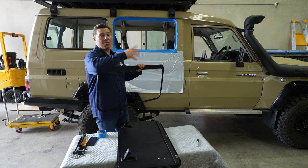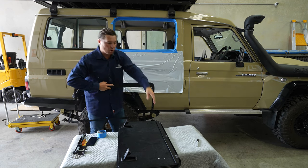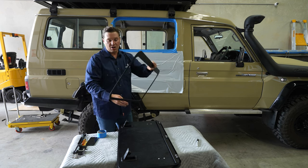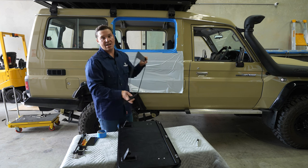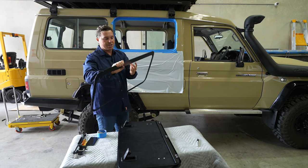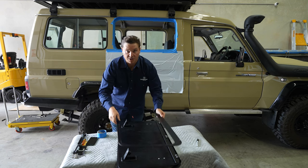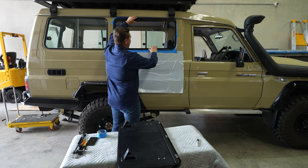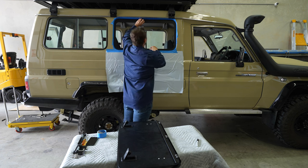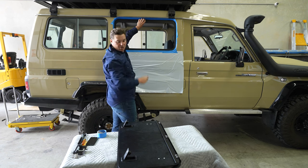When we put the gullwing in we centered it really nicely, but with the texture and the clearance up the top we missed the top holes. So I'm going to grab the backing plate — the pitch of the holes is exactly the same, it's light and easy to handle. Something really important to note is that the middle hole is offset, so you really need to make sure you line it up on the gullwing first and then transfer that over. I'll grab the sharpie and mark these top three holes using the backing plate.